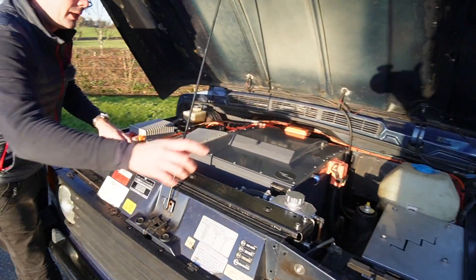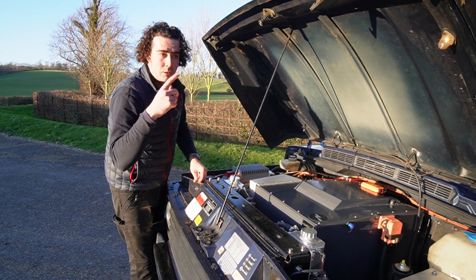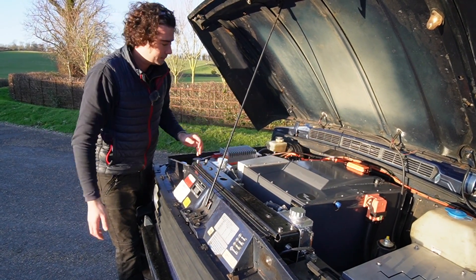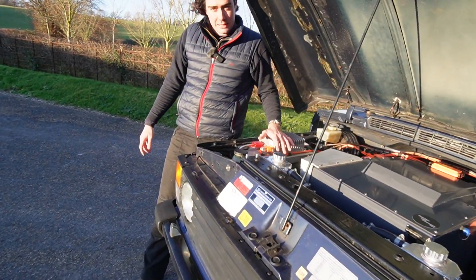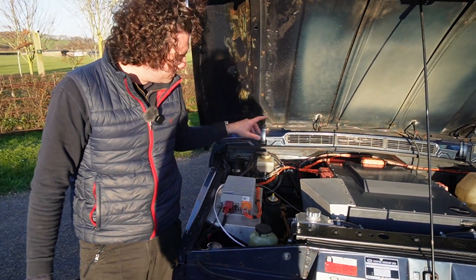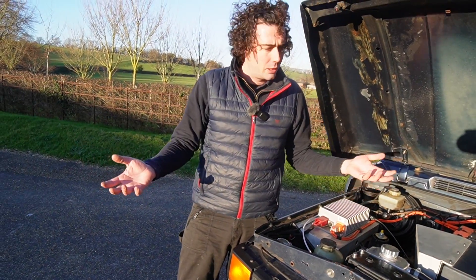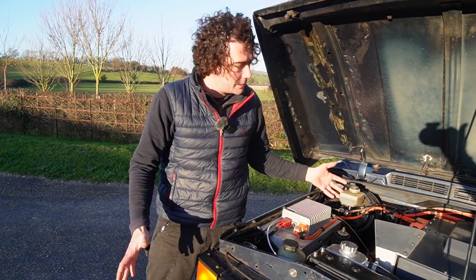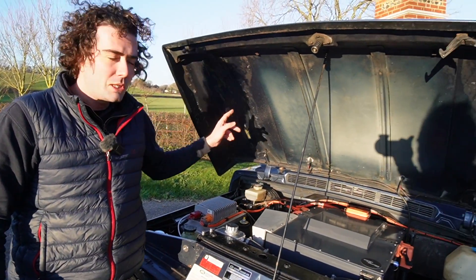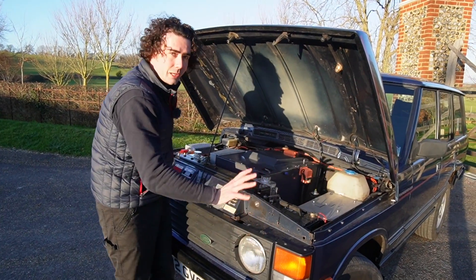This car is primarily built for Clapham. In the front you've also got a full custom radiator pack — two coolant header tanks, one radiator for the motor and one for the battery, not so much for discharging but for rapid charging, because the batteries can get hot pulling around 150–200 amps. You've also got the DC-DC converter, a 12V power steering pump, and a brake vacuum pump that connects to the original brake servo — a couple of things that are often overlooked during a conversion.